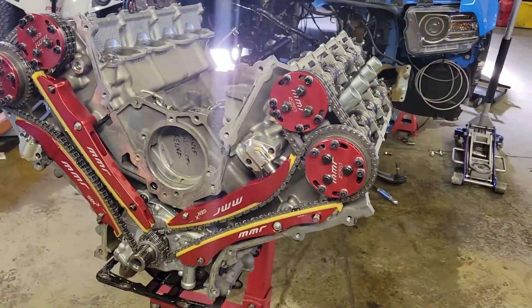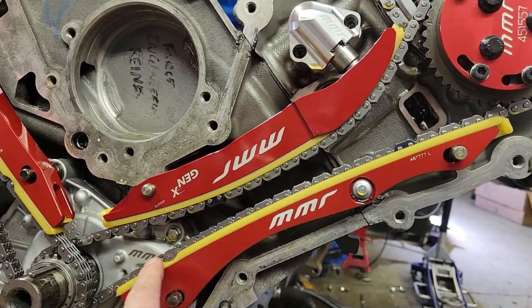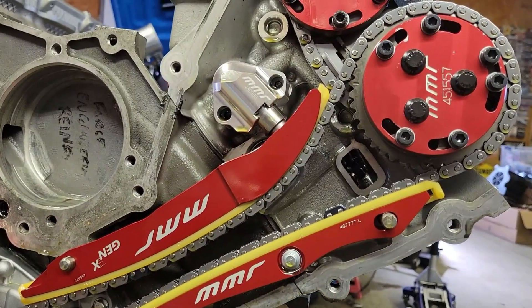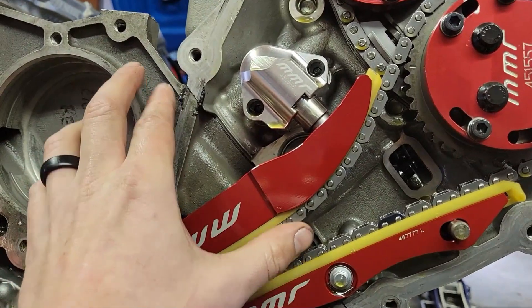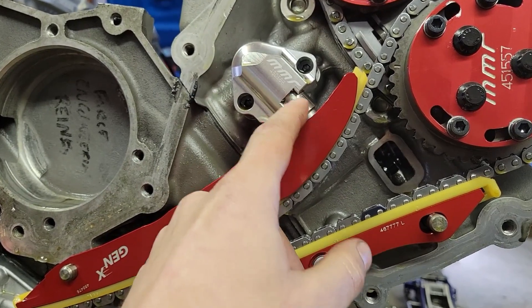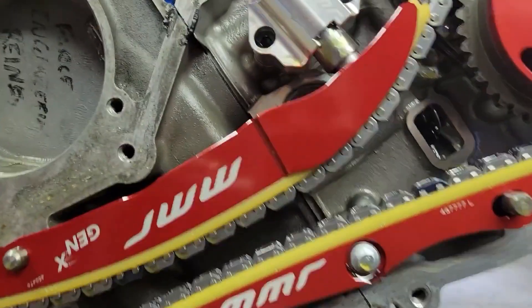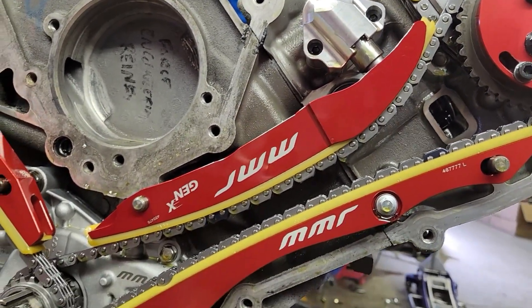Getting this thing torn down, everything's looking good so far. I want to show you guys a couple things — these injectors are discolored, and I'm assuming that's from the alcohol. I know the white ones aren't supposed to be good with ethanol or alcohol-based fuels. Also, if you watched the half-mile video, the thing made a crazy noise because it lost oil pressure. These tensioners are oil-pressure-driven only — there's no ratchet mechanism to hold it out, no travel limiter. So when it sees tension with no oil pressure, it collapses all the way and makes a bunch of noise — that's what we heard and thought we blew it up.